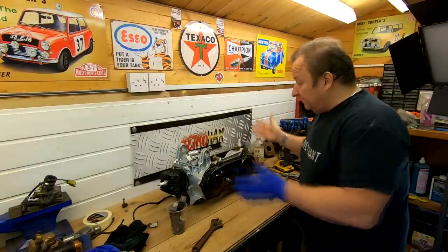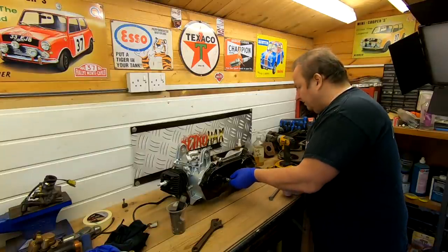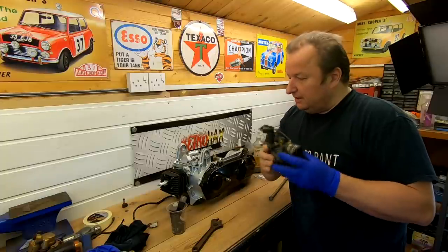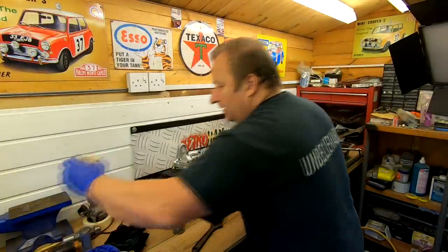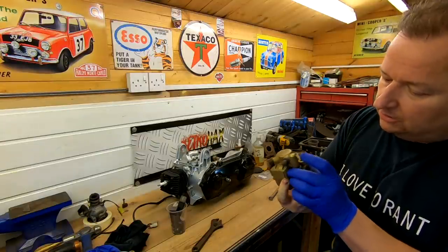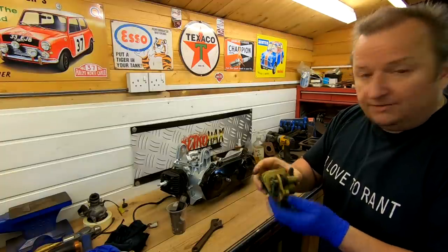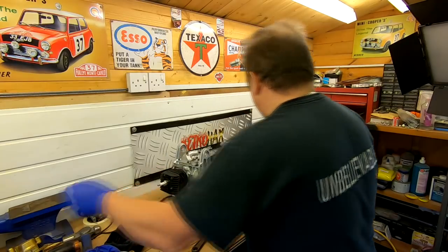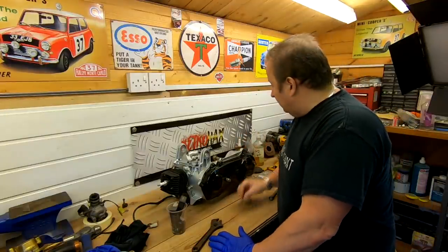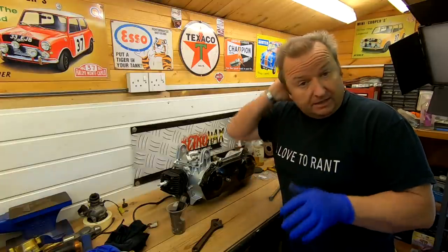What I'm doing here is just cleaning parts up now. The engine's ready to go back in - it's just a matter of finding the little things. The kickstart, which I've got on there. I've got the carburettor which has got to be cleaned and serviced - I should probably end up putting that in the ultrasonic cleaner. There's the brake caliper there, which is actually in pretty good nick. I'm not going to strip that down - the pin slides in and out fine. So there's a good chance I'm going to leave that as it is and just give it a clean-up. I've just got to get this back in the frame and top the gearbox oil up in the back here because that was leaking out at one stage.